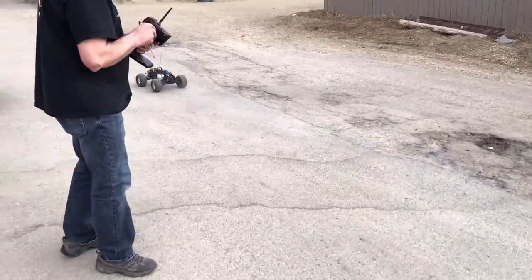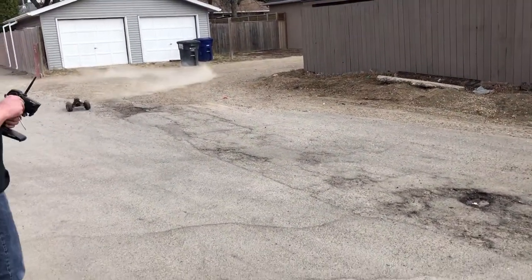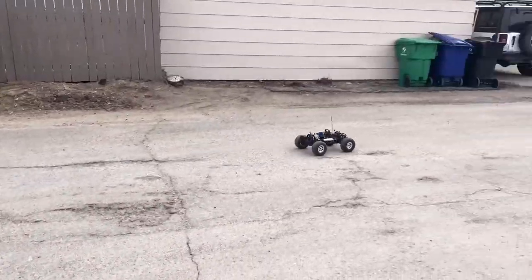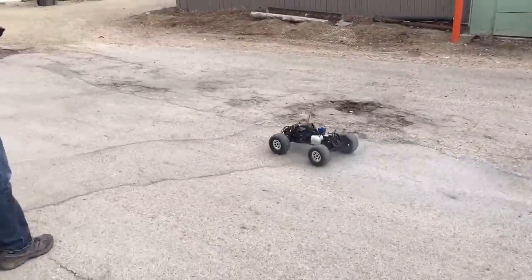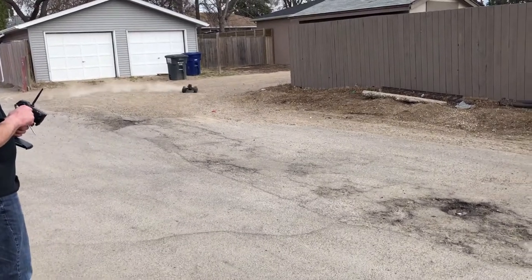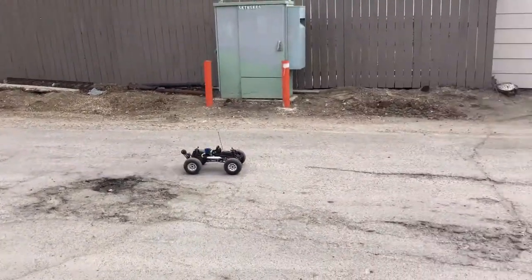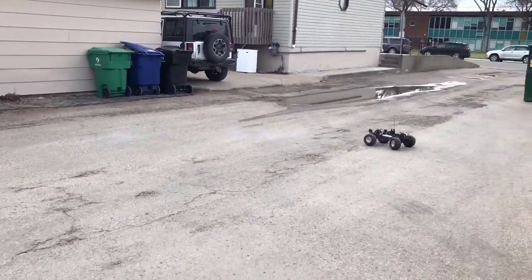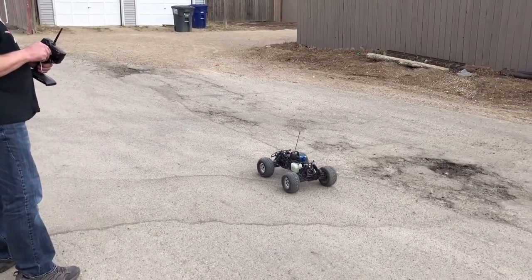So with most of the engines we see here in store, the tricky thing is the low speed needle is always a little bit too rich, and then the idle gap is too much. And when that idle gap is too much, you'll get a really, really bad hanging idle. So that's something we're working out right now. But as you can see, the engine has quite a bit more snap. Still has quite a bit of blue smoke, which we will run this guy a little bit rich.